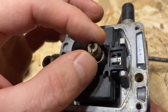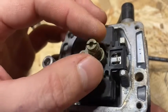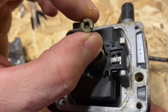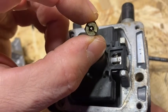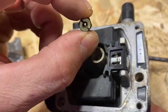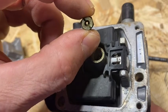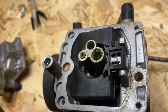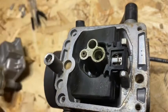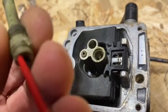First I'm gonna go after the big boy here and just undo this main jet with the 5/16ths - and that is just freaking disgusting. We had an ethanol podcast and Dr. Bob said that ethanol doesn't do this to carburetors - so this one's for you, Dr. Bob. Look at that - the thing is clogged. Not all the way clogged, which is why it was running on choke. We need to clear that sucker out.